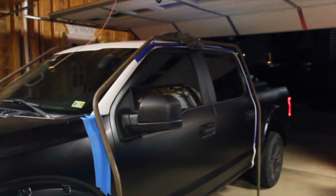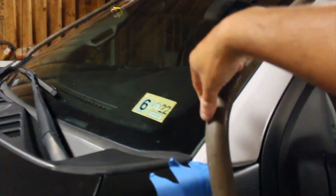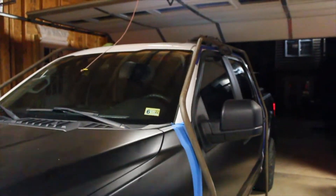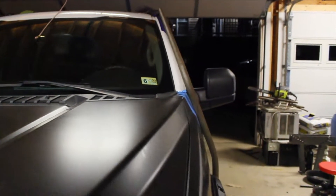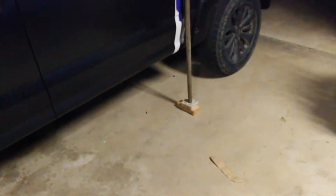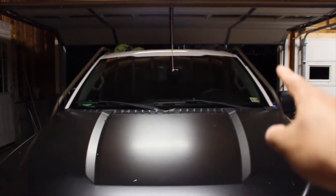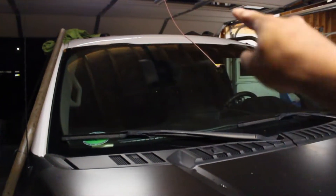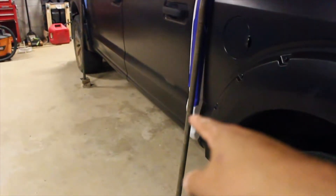That is dope. I'm not sure yet, but I could potentially weld one here all the way to connect to the bottom — we're going full-on Mad Max if I do that. We've got a cage on the outside. Again, this is just mocked up — look what's holding it: granite blocks and my hoodie so it doesn't scratch the paint. It's almost symmetrical; there are different heights right now, but that's damn near close. I'll happily take it considering the machinery we have. We're gonna have to follow the curve and notch off both ends of the tube to weld together, tying in the top part. Same deal for the rear — just a slight bend, notch off both ends, weld it so the top part stays together.